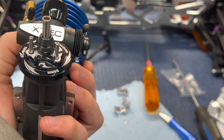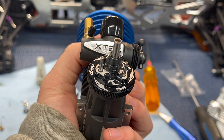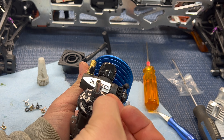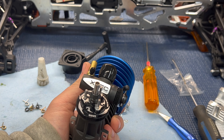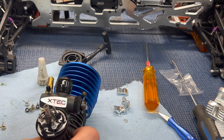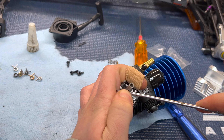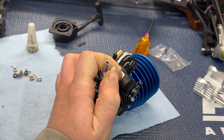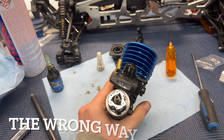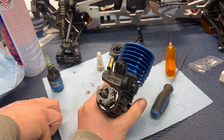That glitter can kill your engine, especially an engine this small. It may even help if you had an ultrasonic cleaner — remove your bearings first, throw the bare block in the ultrasonic cleaner for like half an hour, blow it out, then spray it with some brake clean, blow it out with compressed air. Especially with these Taiwan engines you might want to do that. Classic SH trick — 13 millimeter oddball crank. Not quite sure where I'm going to get some decent bearings for this.